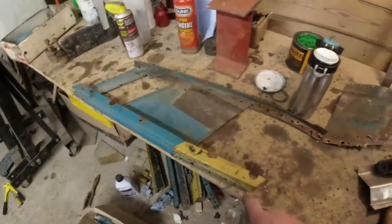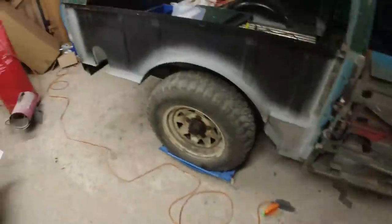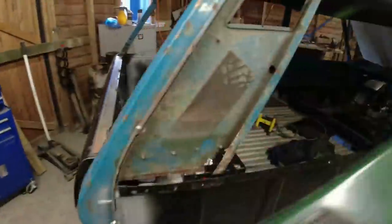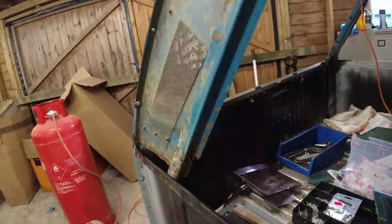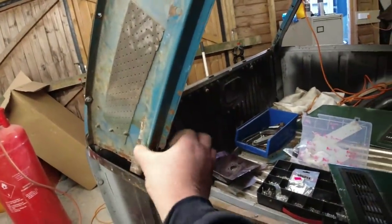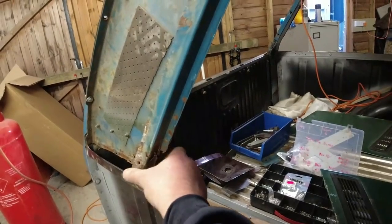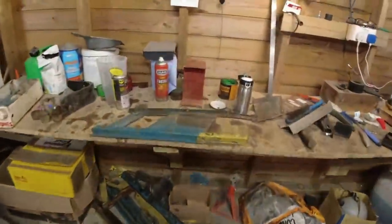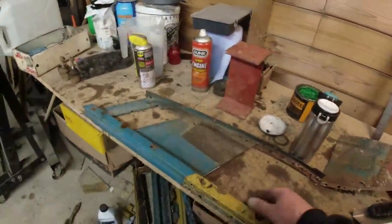That's a much longer repair required on this side than here on the back end of the car. I'll just take the D-post off again. Here, we've got quite a localised area to repair, and I can probably get away with that just with some very, very light shrinker stretcher action. But this one, that's a fair amount more. You can see this.